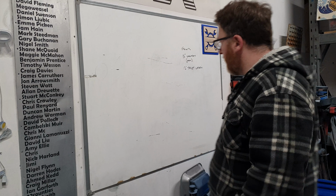Okay, that whole rear measurement load of guff from the last episode is literally that, a load of guff, because none of it has a bearing, because now we know that the shocks in the rear were still sitting on the bump stops, so it's irrelevant. We're going to have to start from scratch. In order to set this ride height correctly, we are ignoring arch gap, because remember, the rears are the only things that actually have gaps, because the front arches are an integral part of the wheel. So none of the arch gap measurement is going to make a difference.